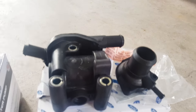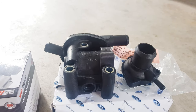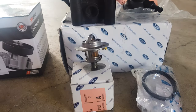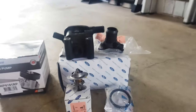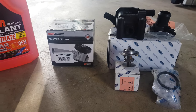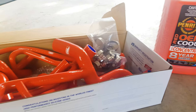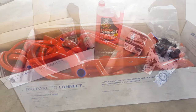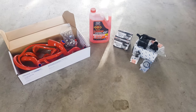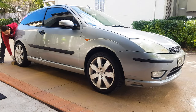I'm not sure what state the water pump is in so I'm going to replace that. I'll be swapping the thermostat housing — the part that caused me to do all this work — and while I'm in here I may as well swap out the thermostat too. It would be silly not to since it plays such an important part in keeping your engine at the right temperature, and since I have the coolant drained and hoses disconnected anyway. So the first thing we'll need to do is drain the coolant and flush the whole system, and to do that we'll need to get the car in the air.